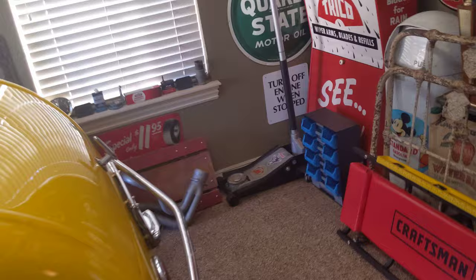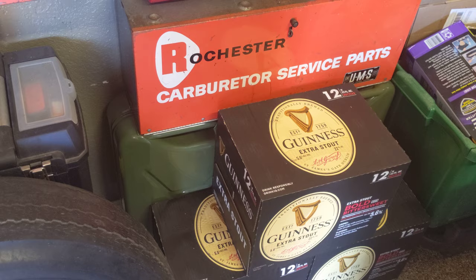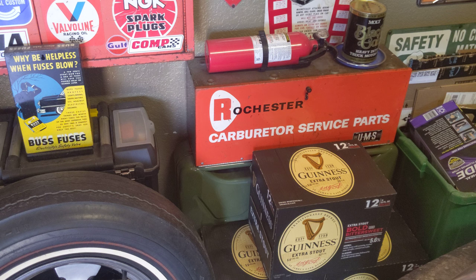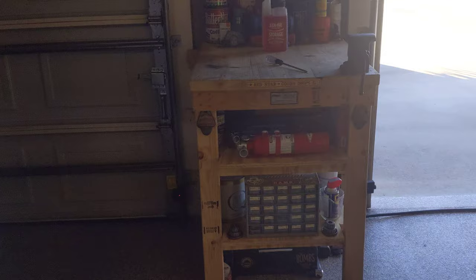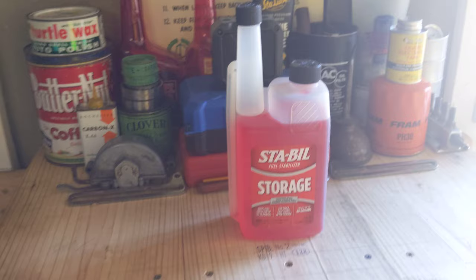It's really crazy — they ran a lot lower pressure back in the day than they do now. For gasoline, I use only ethanol-free premium gasoline. I put it in here in the trunk — it's a very difficult tank to fill because it's a small flat one that only holds maybe about 10 gallons. Over here you can see two green gas cans back there underneath the Rochester carburetor parts. Those are modern ones I purchased a few years ago, and I keep ethanol-free premium gasoline in there — as high test as I can get, around 91 octane. The ones I get are blended from race fuel so it's actually closer to 95 octane. I add the prescribed amount of STA-BIL, and I generally only let my gas sit for about six months — though it states it's good for up to two years.